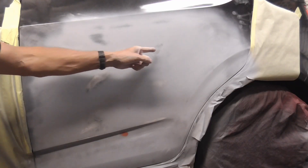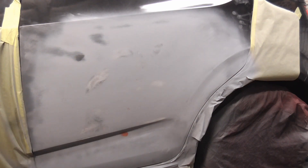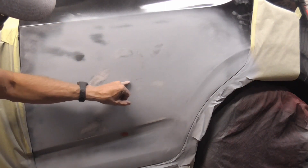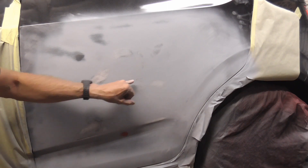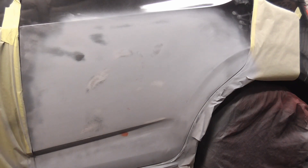After finishing, you can see we hit metal, and if these areas are too high, you're going to have to tap them down and fill it. But I think we're going to be okay. We do have a little bit of a low area here — it's just barely visible, the dark spot right in here and one spot right there. We'll fill that in with some putty, block sand it, prime it again, and probably block sand one more time.